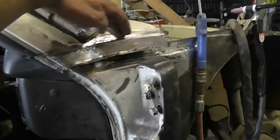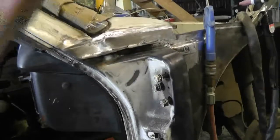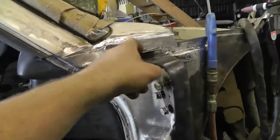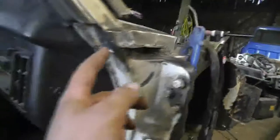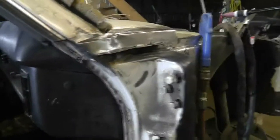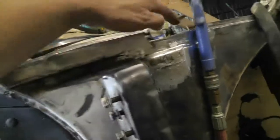It doesn't look great, mainly because there's so much pitting up along here. Unfortunately there's going to be a fair bit of bondo up in here. Anyways, I filled in this area. I only welded in a few spots along here because I didn't figure it was a structural piece, so it wasn't going to be a problem. I had a hell of a time welding up in here because it ended up being a bunch of lead in there. So this is piece number two, and it's already mid-afternoon. Piece number three will be this piece here — I'll tie it across into here. I haven't welded this little seam here because I don't know where it's going to end up getting cut down to, so I'll weld it when I bring that piece across.